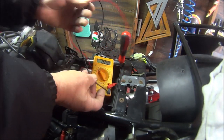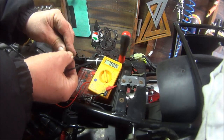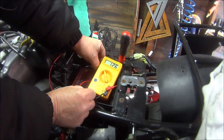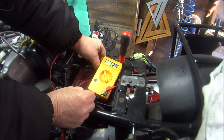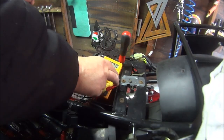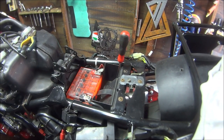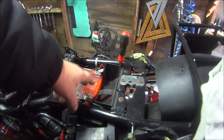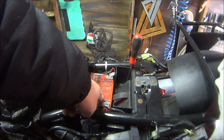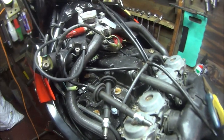I've got my multimeter to see how many volts we've got in this battery. We've got 12.9 — it was 13 point something when I was in the kitchen. That's 12.9, and that's been holding charge since last night. But I must admit after a few days the charge does just disappear, even though I'm not touching the bike. I have heard that these gel batteries are not very good in the winter — they don't like the cold. So maybe it's something to do with that.